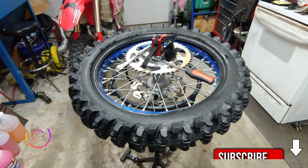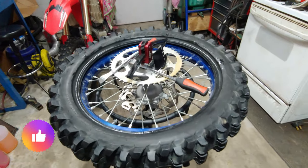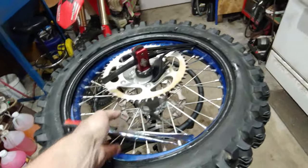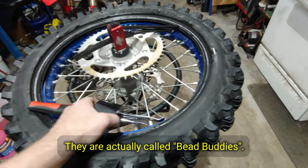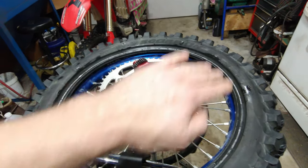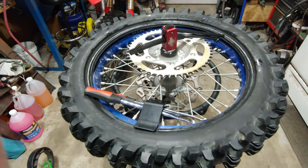I don't know how many of you have ever used one of these stands or if you've ever even seen one of these tools. You have your basic pry tools here, and then you have your bead lock — I highly suggest getting one of these if you don't have one. This tool is called a no-pinch tool, and basically what it does is use leverage to force the bead of the tire over the rim.